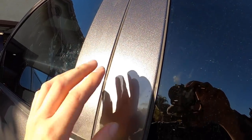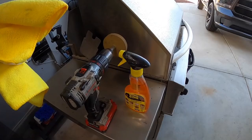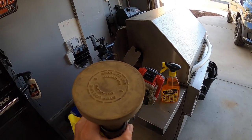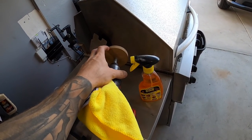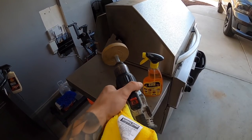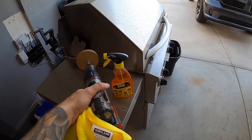Got most of it off. Leave it in the sun for as long as possible, then take it off. If you do have a ton of glue left over, here are the two things that are gonna be your best friend: Goo Gone — you can pick this up almost anywhere, I'll link it below — and this rubber wheel that goes on your drill. You spin it and it just picks off any glue and grabs it without damaging the paint. Just don't go fast — that's the only caveat. Going too fast will burn the clear coat, but going slow will not damage your paint. It grabs the goo and turns it up, then you just wipe it off with the Goo Gone.